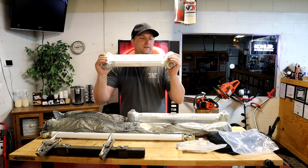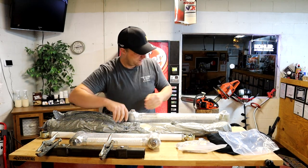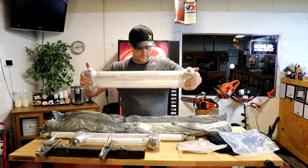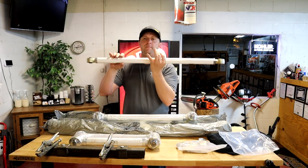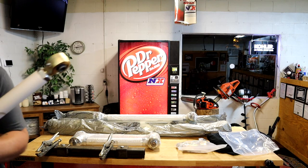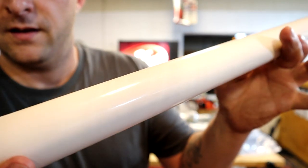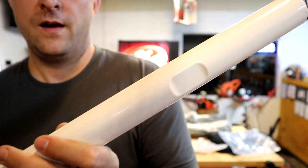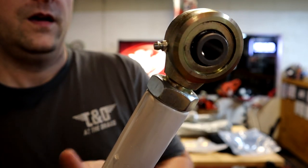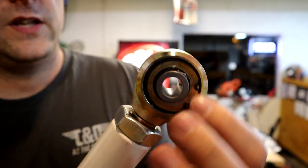I believe these are going to be the two upper bars — these are the shorter ones, they're wrapped up pretty good so I'm not going to take them out right now. And then these should be the two lower bars, they're also wrapped up. So this guy right here should be my panhard bar — I'm going to bring this to the camera so you guys can see it a little better. All right, so there you go — these are powder coated white, these are going to match Frostbite to the tee. These are going to look badass underneath the truck. These are the Johnny joints on both ends, greasable right here, and I like these ends because these things are sealed up really good — they got snap rings in here.